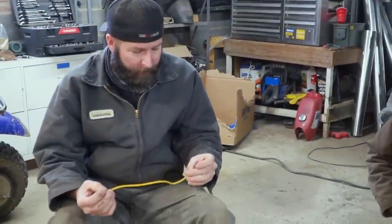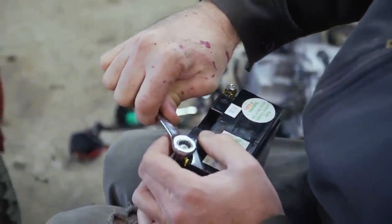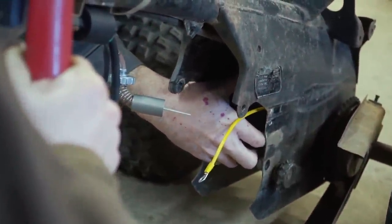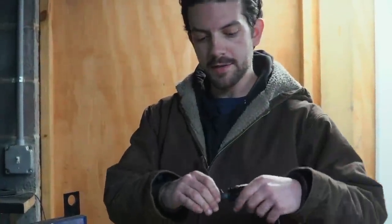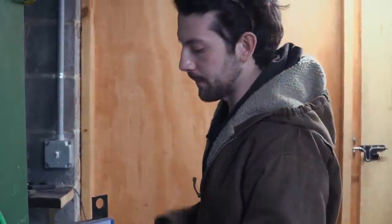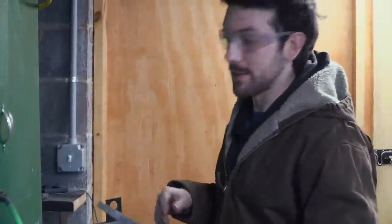Nice ground strap, dude. It's yellow, but it should work fine. The brake — yeah. So since we have to use this ignition key system, I'm going to build a bracket so I can install it right here and mount it to the frame without having to cut anything. It'll be a nice, discreet location. I already drilled a hole in it and I just need to touch it up with the file.